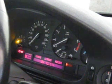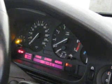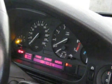In this case you can see the battery voltage is pretty low, in the 12.2 to 12.3 range. At this point I would advise you to recondition or replace the battery. Anything below 12.25 volts is considered a battery with a failed cell.